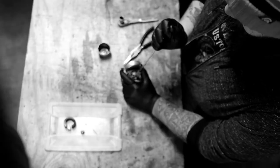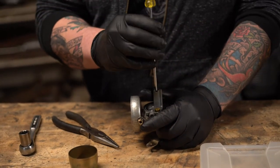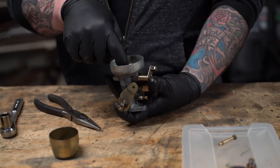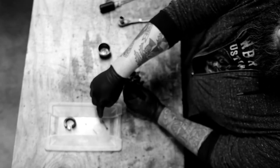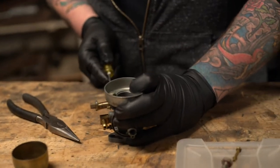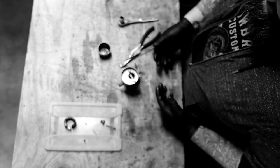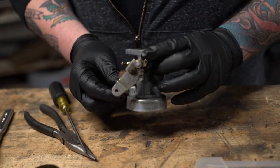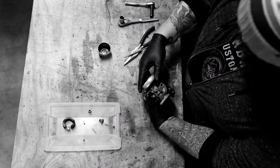With those out, we're going to remove the nozzle. The vacuum of the air coming through the carburetor will pull fuel through the hole in the main jet, through the jet, through the nozzle. We're making sure all those things are clean with no gunk in them. There's another jet in the top — that's your idle jet. It's the jet that lets a tiny trickle of fuel in to keep it idling if you're not using the throttle.